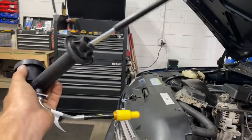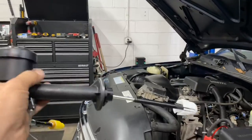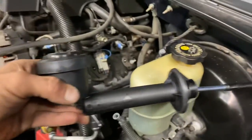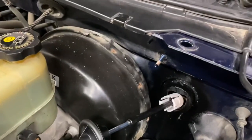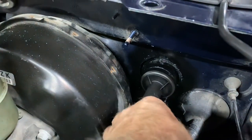We got our master cylinder as one unit. We went ahead and put our push rod installed. Now we're just going to feed it in the same way I put on the mock-up one without the rod. You guys don't mind my hinky spray paint job. I'm gonna feed it in there and just halfway get it in place, just kind of seat it in place. Then we're gonna go in to the little white ball piece that just snaps into the back of the clutch pedal.